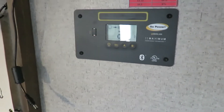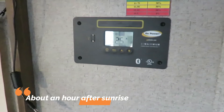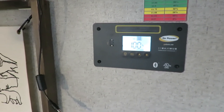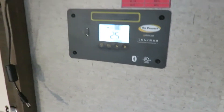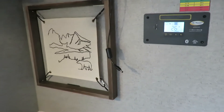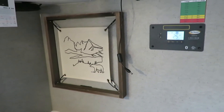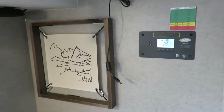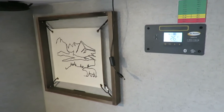Surprisingly, once the sun came up this morning we bumped up to two to two-and-a-half amps of solar charging, and it took our batteries all the way back up to 100% from about 79% where it was last night — so it went up really fast. It just goes to show that if you've got solar running, you can use some things quite a bit, but if you're running strictly off the battery it does run down. We started last night at about 89% and went down to 79% — that's without any solar.